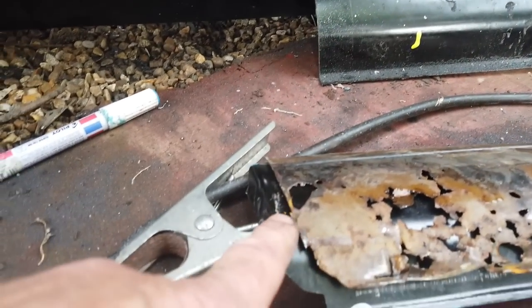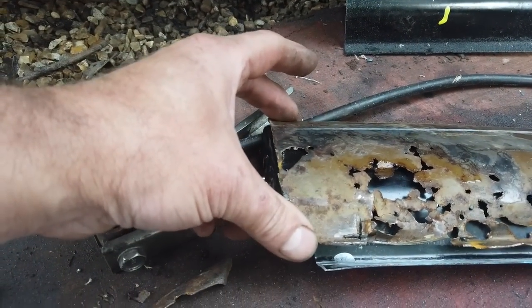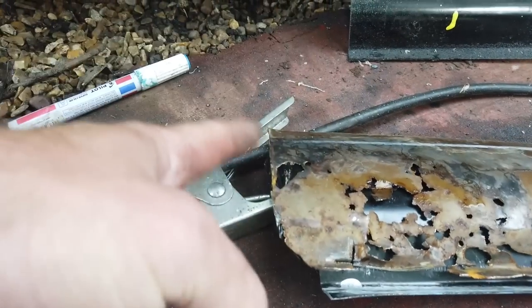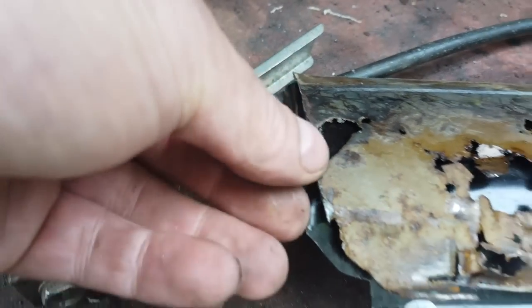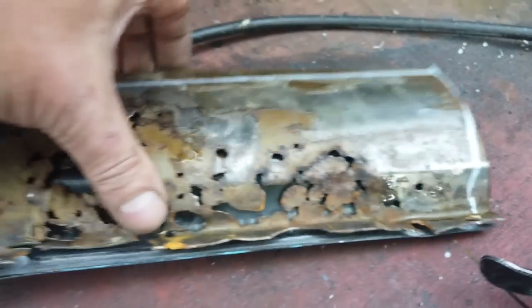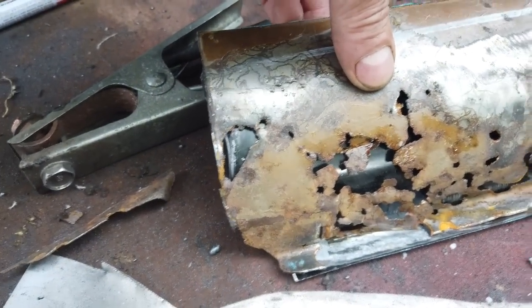You've got to remember, if you put this over, not to have the end cap overlapping this, because it will be too short then. You've got to cut the end cap off the old sill piece and put it in level with it like that, so that this length's correct. In other words, if you're over doubling it, you're shortening that end.